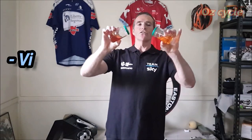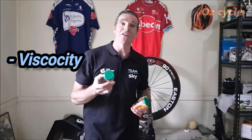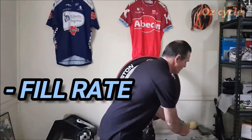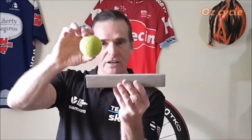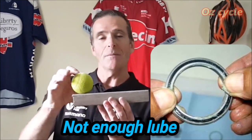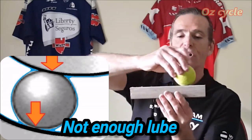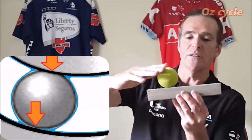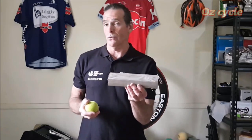It's not only the viscosity of the lubricant you use in your bearings — it's also the amount of lubricant you use in your races, called the fill rate. If you don't use enough lubricant, at the contact point it can be squeezed out and run dry, effectively damaging the race as well as the ball bearings — that's premature wear. If you use too much lubricant, first of all you're adding a lot of friction and the bearing is not going to spin very well.